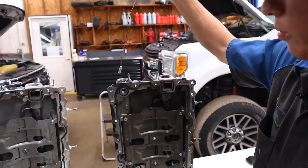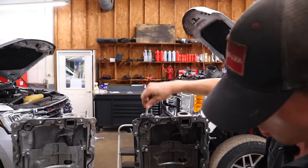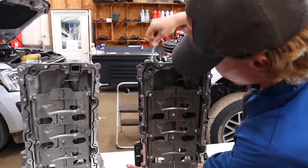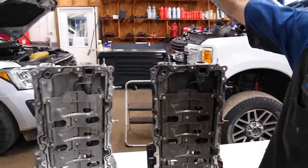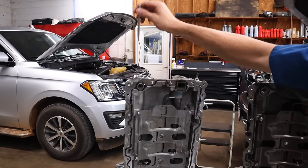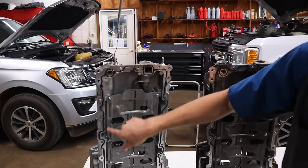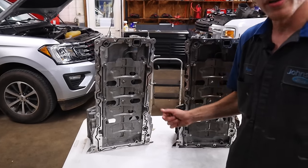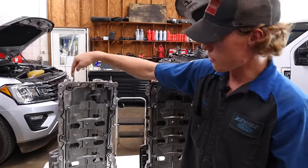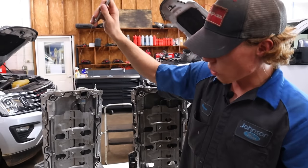So here's the old pan. It goes all the way down in here — you see how long that is? Watch what happens when I put it in this new pan. Okay, this is the tube that supplies oil to the engine. It goes from here to the oil cooler, to the oil filter, and then into the engine. If you can't get oil down this tube — which I'm showing you right now — you can't. If I poured water in this hole, it would literally fill all the way to the top. It will not let any oil flow through.